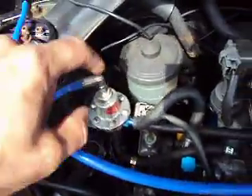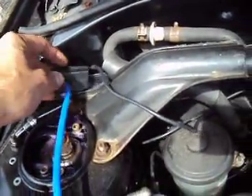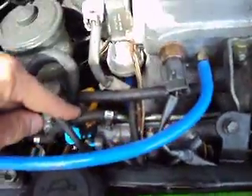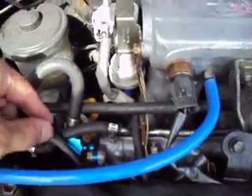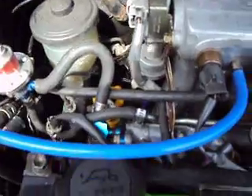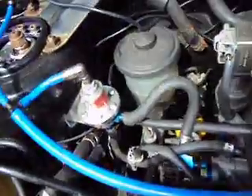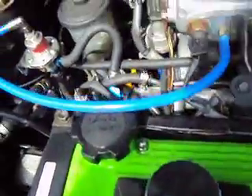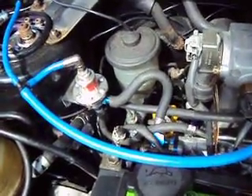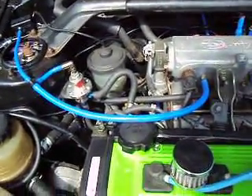That top pipe is connected up here and you can also see it's connected to my boost gauge in my dash — my Pro Sport one. For the bottom pipe, you'll have to cut off your standard fuel pressure regulator — it's a little round silver thing — you just chop it off directly on the pipe and stick this straight on, and that goes to the bottom of your fuel pressure regulator. That will sort out the fueling. Then obviously you'll need to get it on a rolling road to have them set the pressure correctly, because you can't do that yourself reliably.